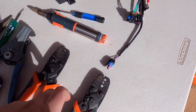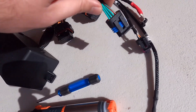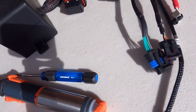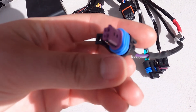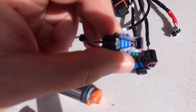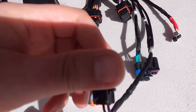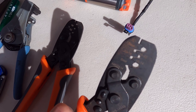I can also use this tool for the majority of engine harness or sensor connectors — for instance, this one here is the idle air control, and then you've got coolant temp. It may not be the same as your coolant temp sensor connector, but I prefer these as they're a push-to-seat and they have terminals with seals. That's when I go back to this crimper to butt up those seals.